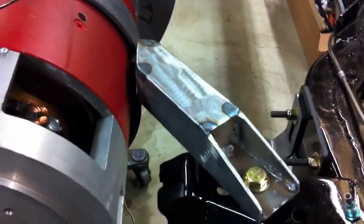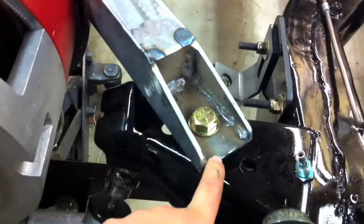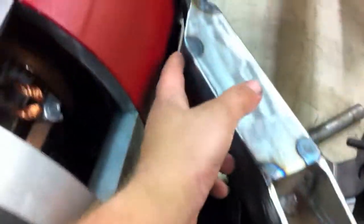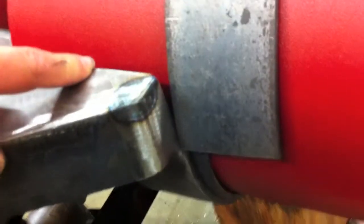I started fabricating the two arms, and the arms are completely made from scratch. Started with a little plate here which was two inches wide and three and a half inches long. I lined up this bracket which happened to fit in with the top of those quarter-inch pieces I was talking about that extended the hoop. So that gave me this side. And then I did this side over here the same way, but I put that nice little bend on it there.